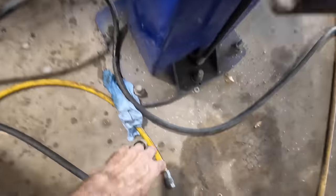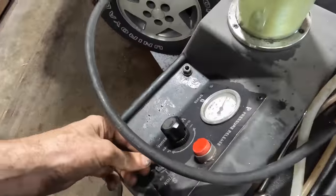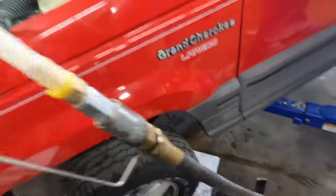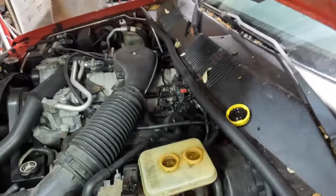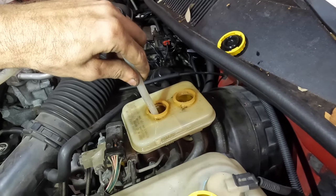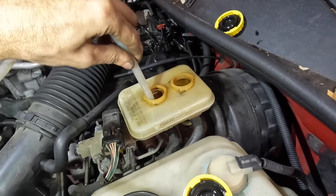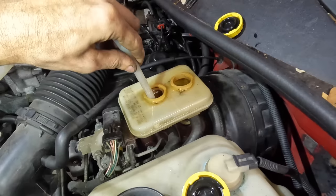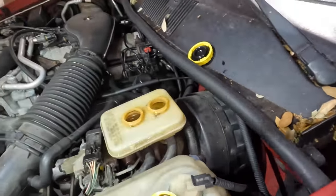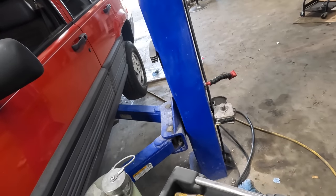Reconnecting the vacuum side and using the suction hose to pull the level down to the max line. We don't want to leave it overfilled because next time somebody does a brake job and compresses the caliper pistons, it'll displace fluid and overflow the master cylinder again — we don't want that. Right there — that's the level.